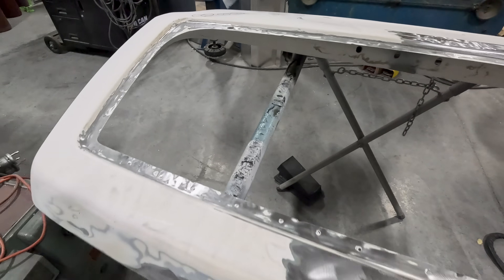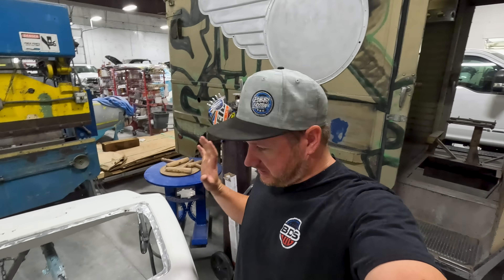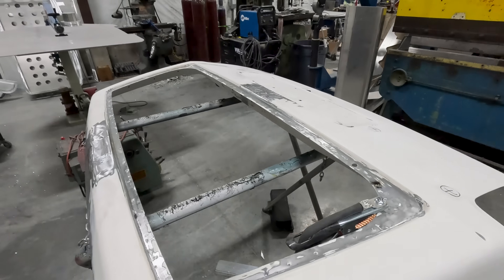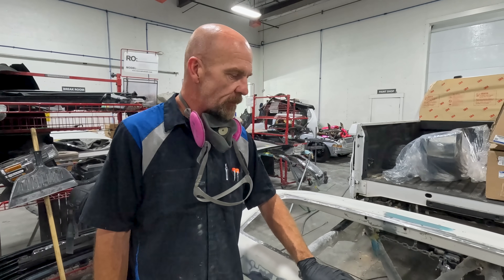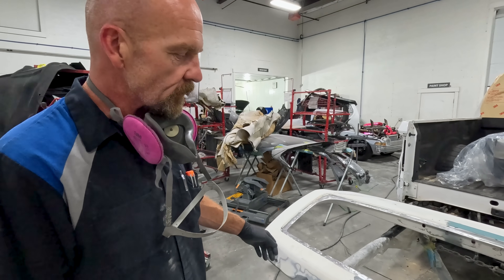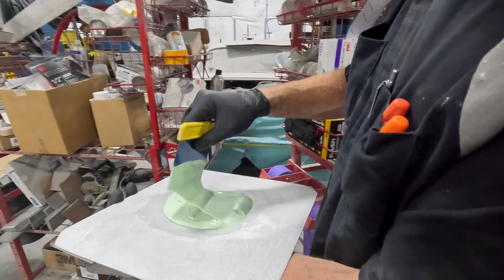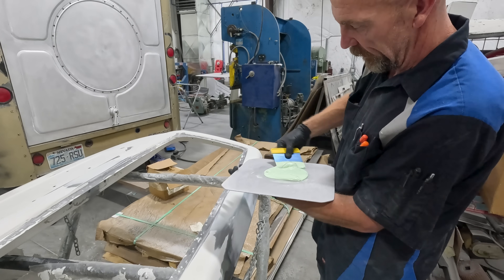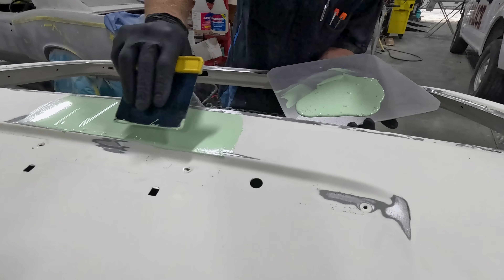Sean said he's going to do a little more, then it's going to get passed on to Cody. Cody's going to do all the body work — fix all the little dents, they're all marked. Sand it down, then he'll prime it. Hillbilly got everything stripped. I'm going to go through and get the glass coat that Sean put on sanded down and smoothed out. We noticed some door dings we're going to fix along the way. A little bit of damage right here — we'll get this all smoothed out and primed, and then it'll be Robbie's turn to work on it when he gets back. Now we've got the body filler knocked down. We're going to mix up some glaze, glaze coat all the filler work, and the little dings we found while going over it this morning.